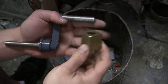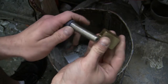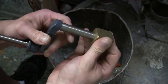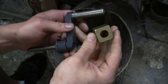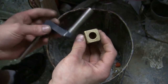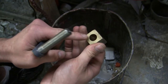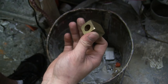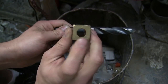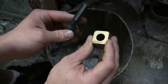The shaft for the swing arm and the corresponding brass bushing block have very, very tight tolerances — so much so that it will either not fit at all or will be so snug that the suspension won't work properly. In order to remedy this, you will need to slightly expand the hole on the bushing to loosen up the tolerances. You can try to drill it out with a drill bit; however, the hole used for the bushing block and the diameter for the shaft on the swing arm is not that of a standard drill bit size.